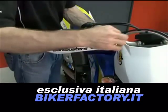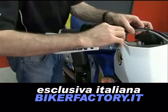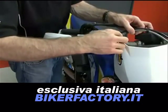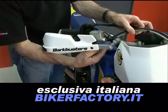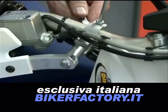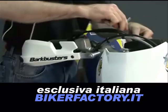First, tighten the bolt through the handguard to the swivel connector of the clamp assembly. Second, tighten the bolt to solidly lock the swivel section between the clamp assembly. The clamp is designed to allow the nut to pull into the recess hole when tightened. This eliminates the need for a wrench after the bolt starts to tighten. Then tighten the other bolt to secure the clamp assembly firmly to the handlebar.